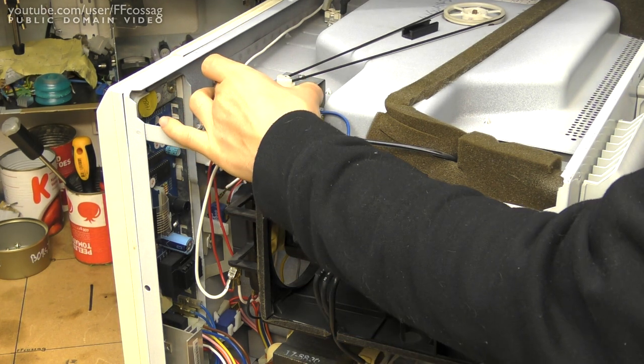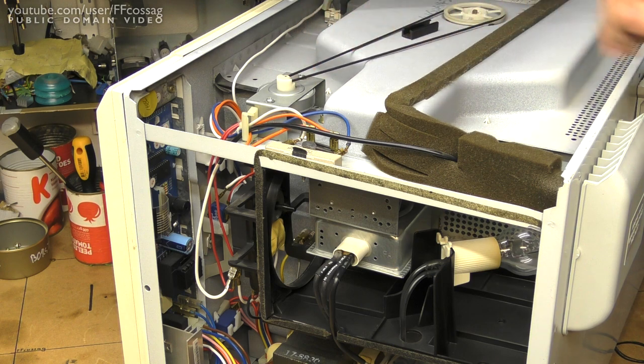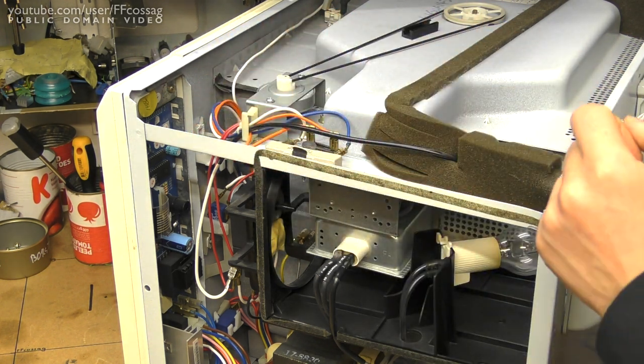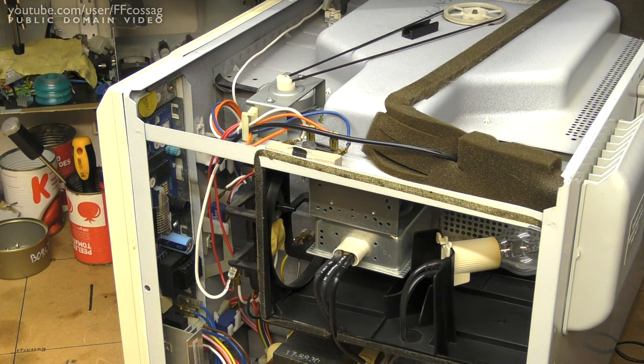The first one being this fan motor, which is making a bit of a rattling noise. I can imagine the bearings being a bit dryer than they should be, so I'm hoping we can get this thing apart and lube it up a bit. The second is the other fan motor, which seems to have rather good lube in it, but since the fan came off anyway, I want to take that out and get some fresh grease on those bearings as well.